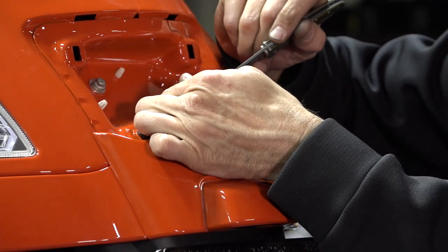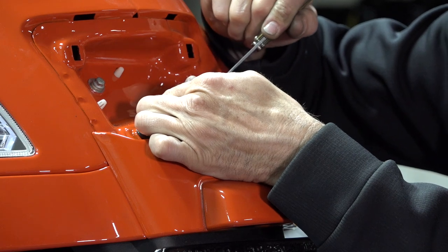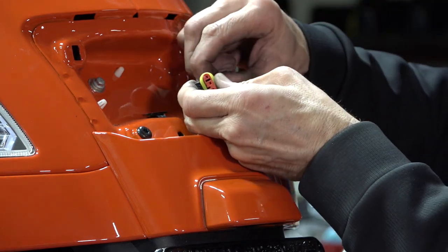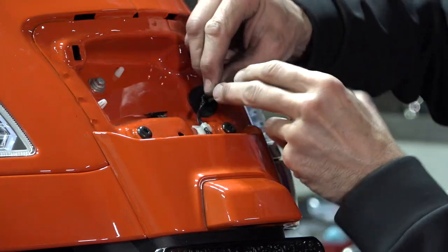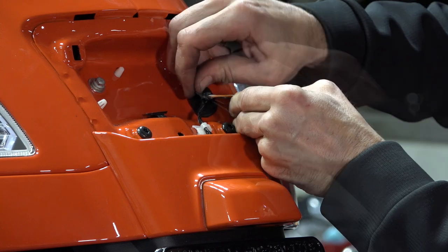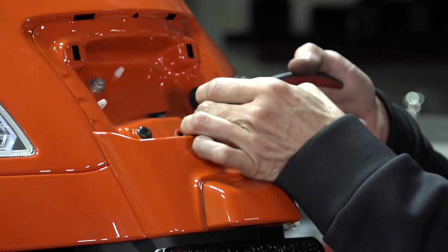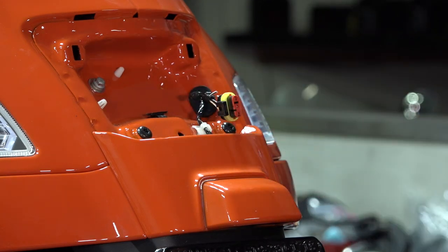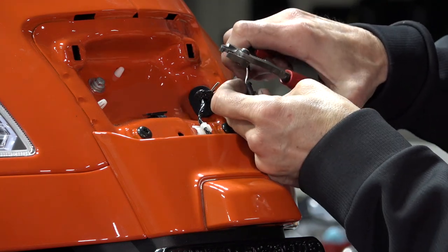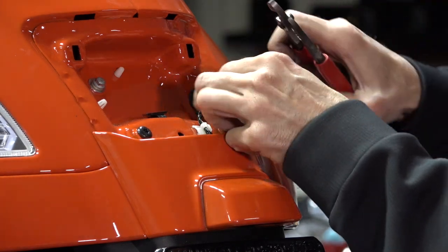At this point you'll see a little zip tie and some electrical tape that covers the three wires. Carefully slice that electrical tape back a little bit right up to the zip tie. It's a little different than the earlier models, so watch my prior video if you're putting this on an older model. The wire you need to clip is the white wire. Go ahead and clip it approximately in half, then take a stripper — it's about 20 gauge wire — and strip maybe 3/16ths of an inch off each side.